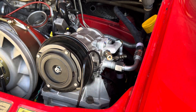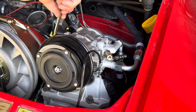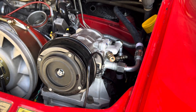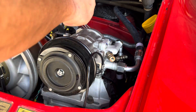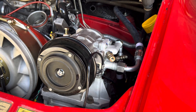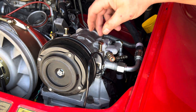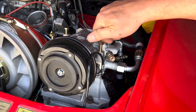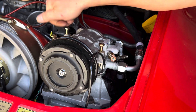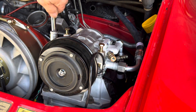We haven't tightened anything down yet. Since these guys only use flat washers, we're going to use a tiny little bit of blue Loctite, and these only go to 25 newton meters. If you go much past that — which plenty of people have — you'll strip out the threads in the very expensive mounting bracket. So we're just going to tighten these by hand.